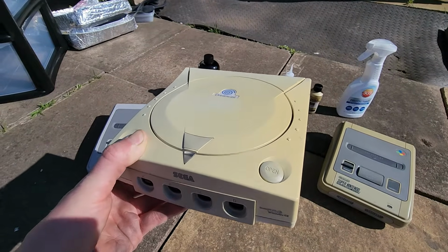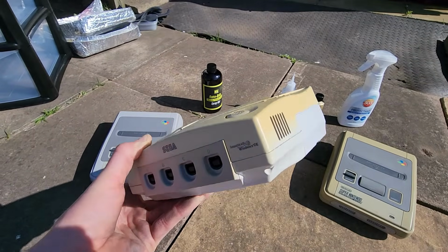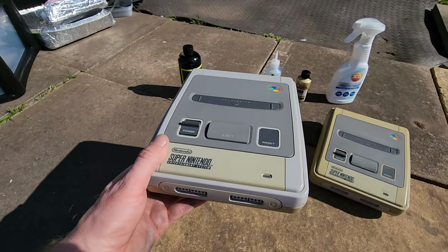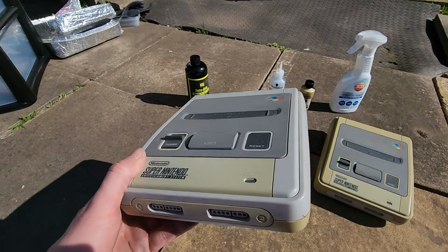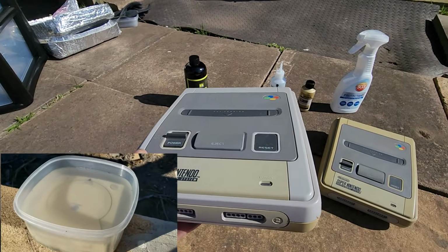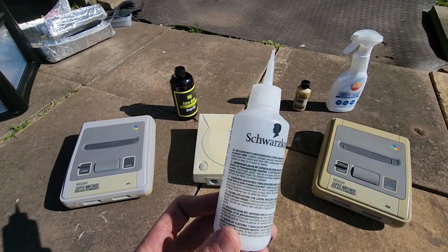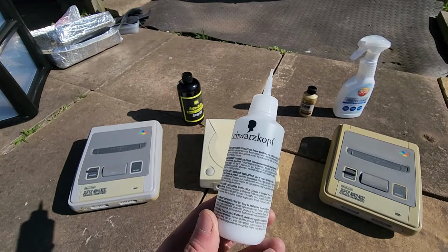Now, if you've never heard of retrobriting or vaporbriting, it's the process of de-yellowing various different types of plastic by using hydrogen peroxide, heat, and UV rays. Typically with retrobriting, we are applying a hydrogen peroxide-based solution to the item itself. This requires the item to be submerged or covered in the solution. Results can vary depending on the solution that's applied. If it's a cream-based hydrogen peroxide solution, then it can create a less than desired marbling effect.